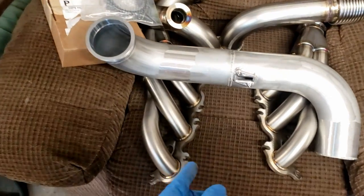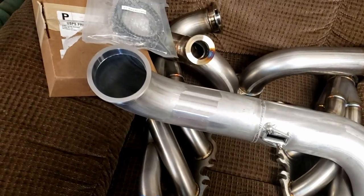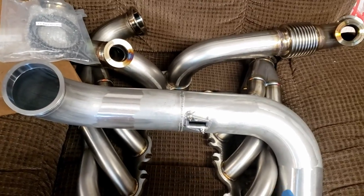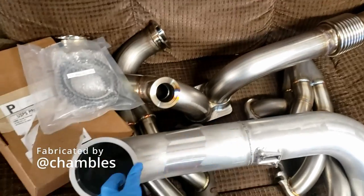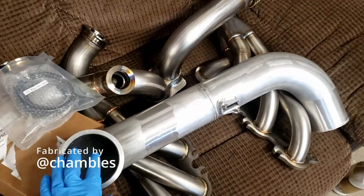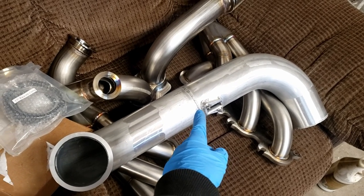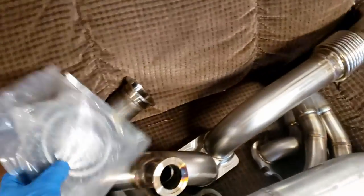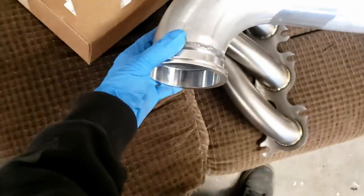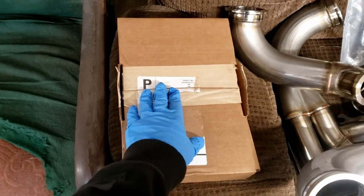This is the new hot side. We have the passenger and driver side manifolds, a merge and T4 flange, and I got him to replicate one charge pipe with the mass air flow in it, just to make sure I have a good signal. Also got him to weld on the Wiggins style flange, and then this is a box with the modified air conditioning lines.